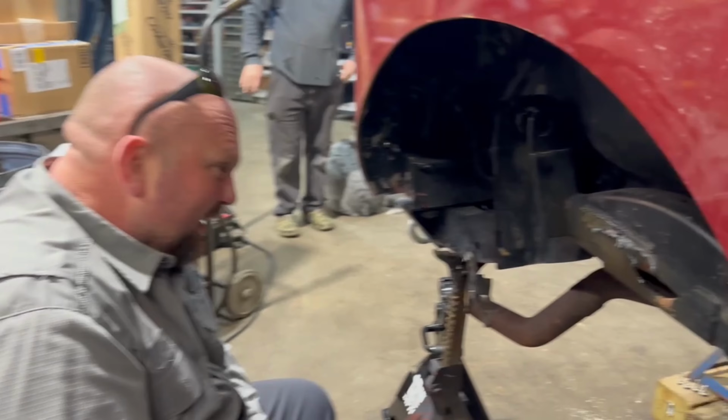We're doing a 14 bolt out of a 05 Chevrolet 2500 HD truck. And then the front will be a 78 model Ford high pinion Snowfighter Dana 60. So we're gonna get started on this. We've already, you can see, we've already torn stuff apart. I had to tear it apart to order parts. We're doing a Yukon Grizzly locker front and rear, same thing we had in the other one.